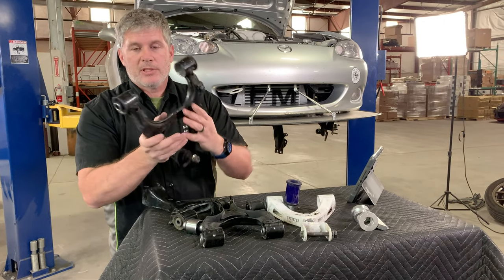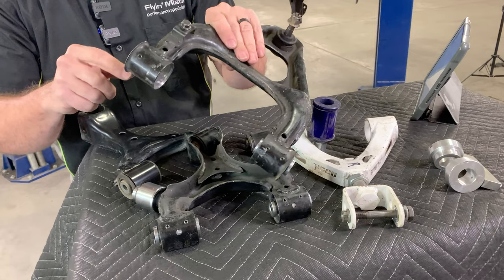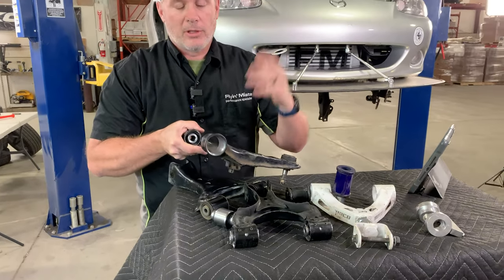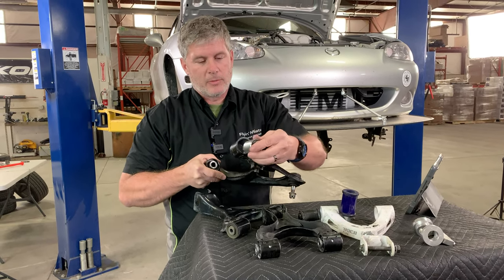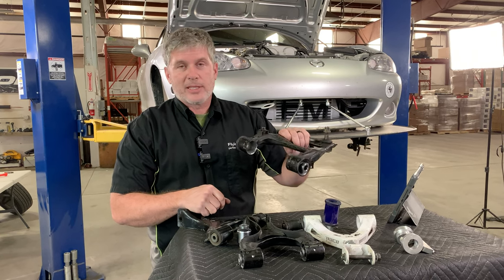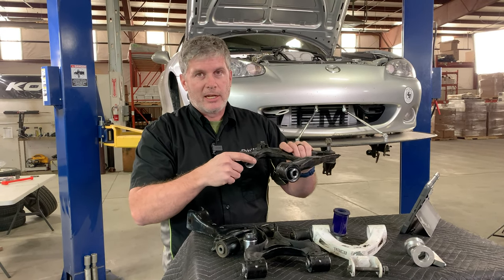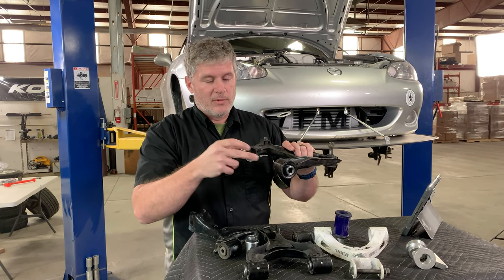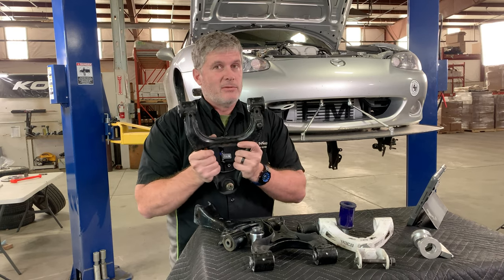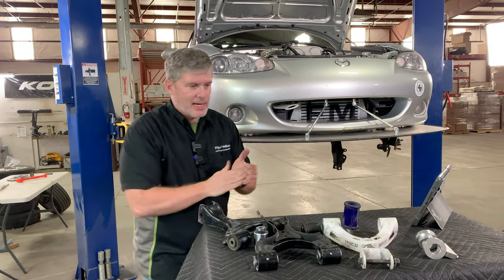Here's an arm that's been prepped — it's got one side done already, and here's the other side ready to go. It's already been drilled and tapped; those are the two holes in there. In this case, we had to clean out the bore a little bit. You just use a ball hone for that, which comes with the installation kit, or you use your own — they're available at any auto parts store. You slip this in, run a drill inside just for a moment to give it a little divot to lock the bearing in place. That's effectively what installation is. There's a critical dimension on the subframe or rear knuckle that you want to get just right, so you want to make sure those divots are in the correct place. We have an installation video on our website if you want to check that out.